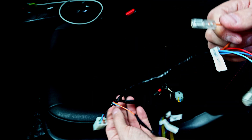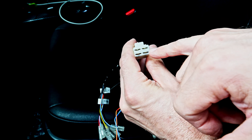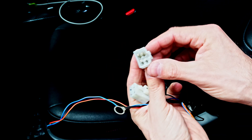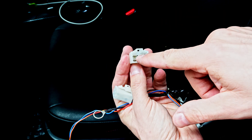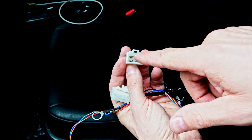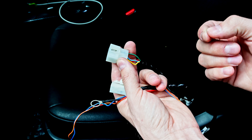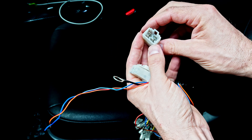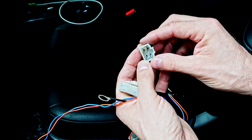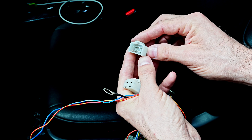Anytime you have to go into a connector — whether it's to repair or because of pin fitment issues — you have to replace the pins. You also need to be cautious of the locking mechanism to make sure it hasn't been in and out a couple of times and become fatigued. If that breaks, your wire is just going to come back out over time and you'll get intermittent issues that can be really difficult to find and diagnose. I hope this helped you out — please leave a comment and let me know what else I can do to help. Have a good one, thanks for watching.